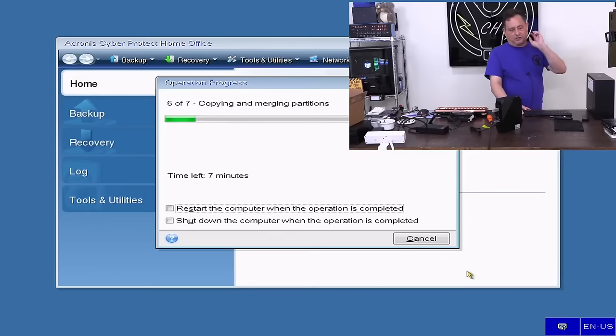Do yourself a favor, go online and try and figure out if the Dell mini PC supports Gen 3 or Gen 4. Let me know if you find any paperwork from Dell that identifies it. It'll say it's M.2, it'll say it's NVMe, it'll say it's Type 35 or Type 40, which again, that's something they made up. But the actual information you want to know, is this Gen 3 or Gen 4? They don't tell you. Nowhere. I looked and looked and I cannot find, outside of discussion groups where people are talking about it, anything officially from Dell in the product specifications or documentation of what generation NVMe is on any of their mini computers.